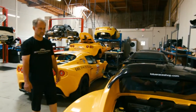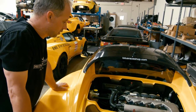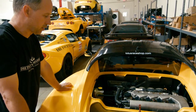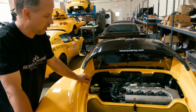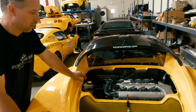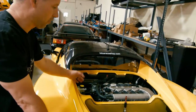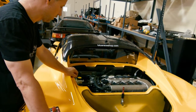As with your street car, as you go more and more toward a full race car you want to keep things reliable. These are the same engines as in the street car — we're not allowed to do pistons or other heavily modified internals. What we generally do on our fleet of race cars is pull the head and replace the valves, springs, and retainers, which is legal and done for reliability. If you over-rev one of these by catching the wrong gear, all it takes is a little piston-to-valve contact to weaken the valve — and it may not break right away. Usually it's the next heat cycle, as you're warming up, that it'll drop a valve and chew up the engine. So we replace the valves proactively for reliability.